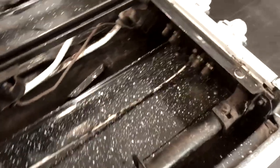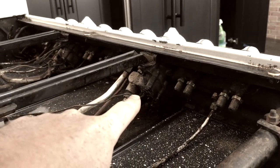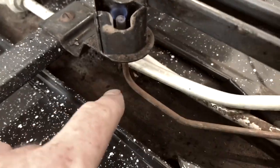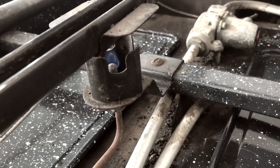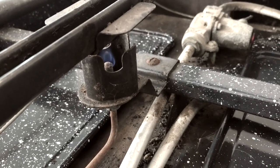The gas comes in and feeds into this manifold piece right here. The manifold basically has all of the knobs attached to it as well as all of the pilot lights. This is actually a pilot light that we have going right now, fed through a tiny quarter-inch line right here. The pilot light can be adjusted via this little screw — tighten it and you'll have no gas going to the pilot light, open it up and you'll have more. Ideally you want a tiny little blue flame. There's not much yellow on this flame, which means it's a fairly good burn — the more yellow or orange you have, the less efficient the combustion is.